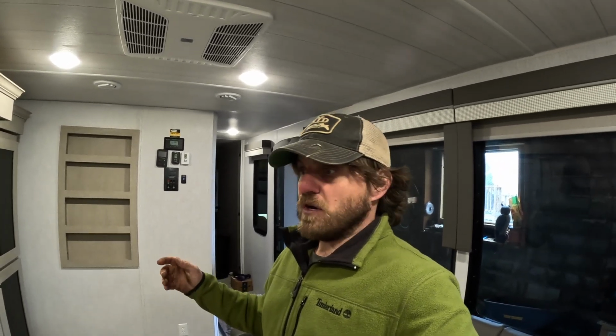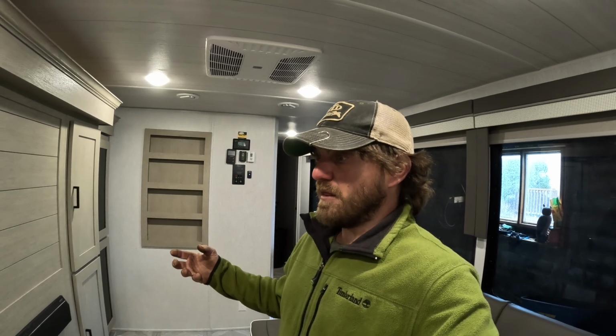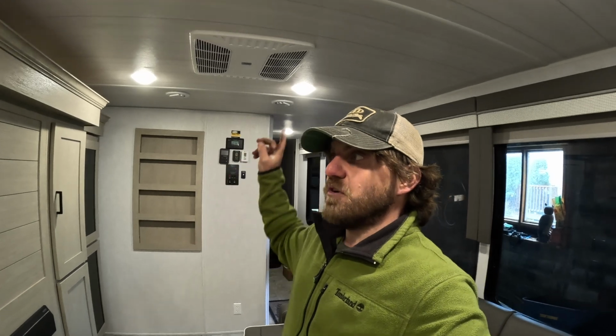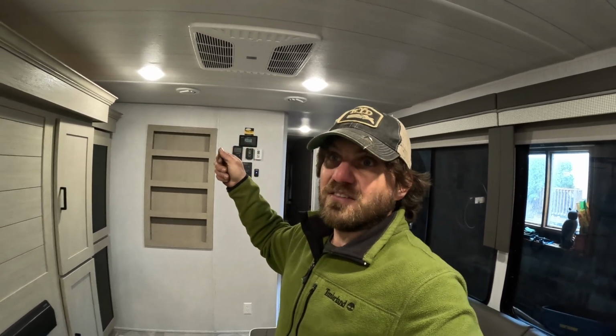And you need one if you're going to be camping in the cold weather. Like when you're running your propane heat, you'll get condensation inside the camper on the windows and every such thing because they're not insulated quite like a house. You don't have the dual pane glass and stuff like that, and the propane heat creates moisture. The quick, easy solution to this, of course, is to open your roof vent in the bathroom. Just crack it, just a little bit.